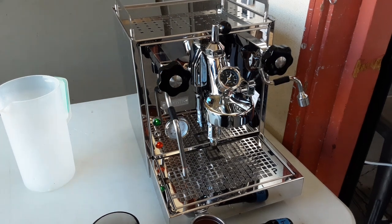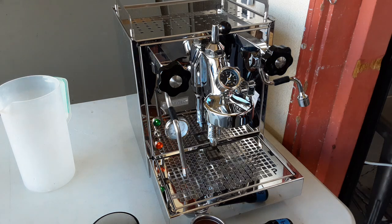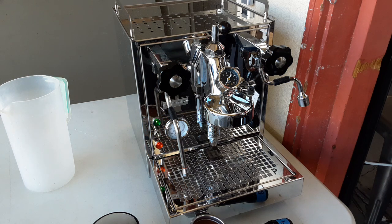What they had been instructed by the place that they received this machine was a relay swap. The customer provided the exact relay, so we swapped it out, and it's working well. After a really long time of leaving it on with the old relay, it would cut off the steam boiler and wouldn't send any more power into the heating element.